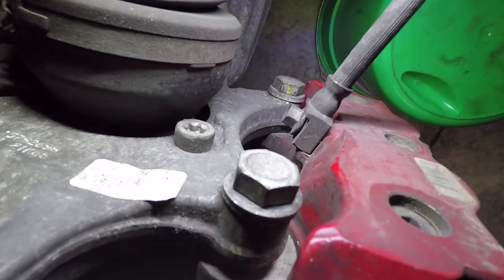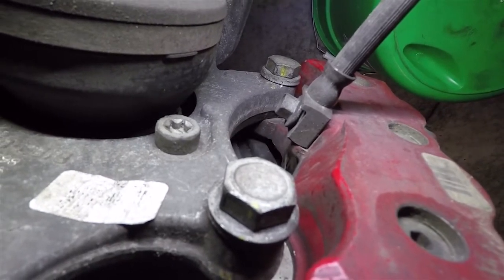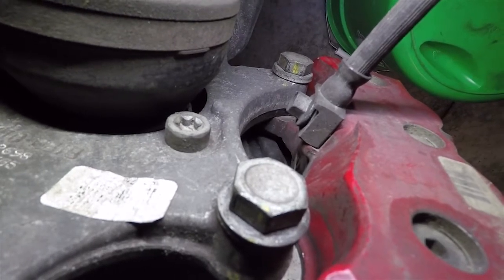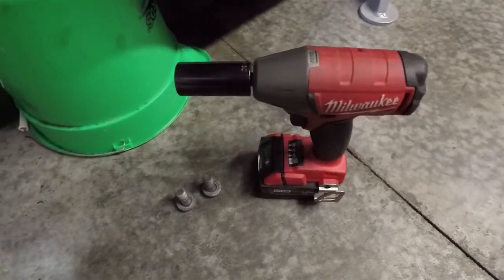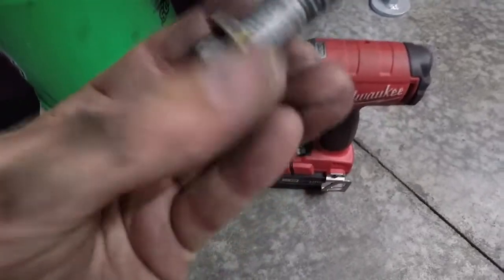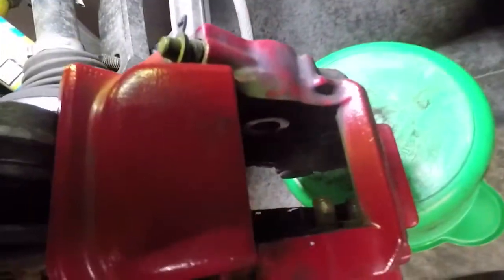I'm gonna start in the back first - they're actually the harder ones to do. In the front I can turn the wheels and get better access to the caliper bolts. The rear caliper has two bolts, lower and upper, at about 125-130 foot-pounds, so it's tough to get leverage on. I've got a big breaker bar, and I'm going to try my impact wrench first. Calipers are off - I am super impressed by this little Milwaukee 3/8 medium power impact. It's only 210 foot-pounds but it zipped these caliper bolts right off.